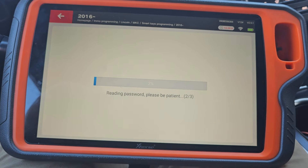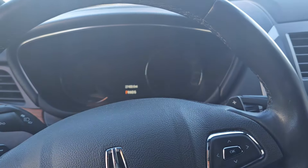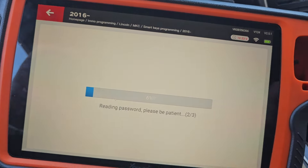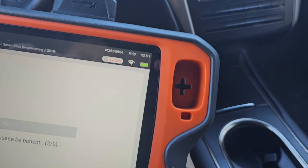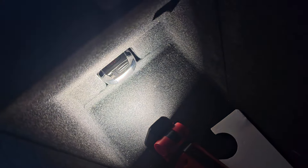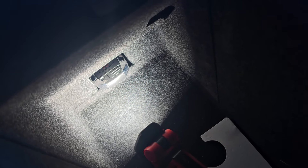So we've seen this before. It has different methods on different cars. The cluster turns off, radio is off. And I did this this time - this one's tough to see but easy to find. Emergency spot slash learning spot - I got my light in there, you can just see the end of the key sticking out. That's where the key needs to go in order to program.